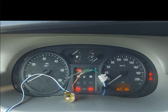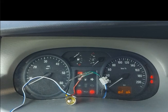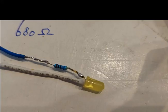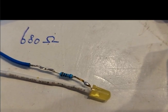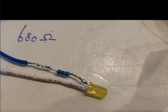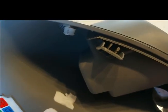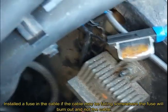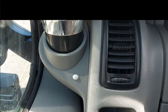Now I know that the outside temperature sensor has no impact on the controlling of the glow time. Instead of a big bulb, I created a little LED light with a 680 ohm resistor between it to connect it with 12V. I'm going to install it here so I always have a check light on my dash. Now I have installed the new LED so I can see the full time of glowing.